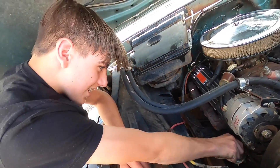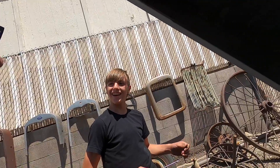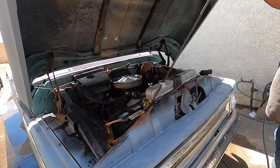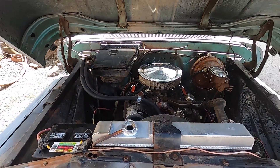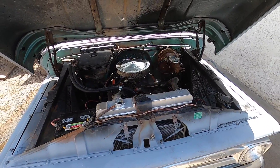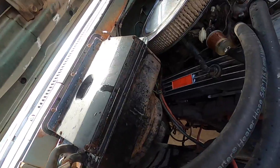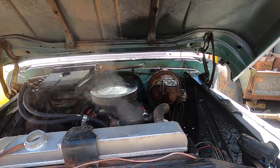Sure, you want one of these old Chevy trucks, kid? It's got an LS in it. Kid wants a short bed, a big back window, an LS. Well I guess he knows what he wants — probably wants AC too, and doors that lock at five miles an hour. We're percolating. I know why it don't run good — it doesn't have an HEI, it's got points. It's probably floating the points. We're going to have to do a little adjusting. We're going to teach Wes what points are. Do you know what a condenser is? You're in for an education today. We're going to get coolant in it, get this radiator back together, and then teach Wes how to dwell a set of points.